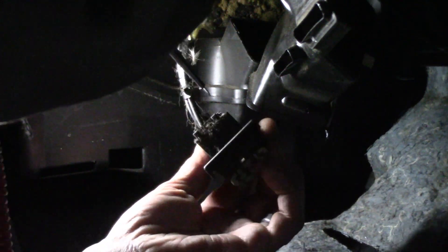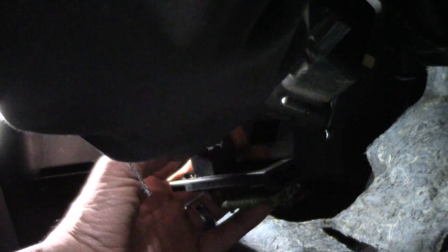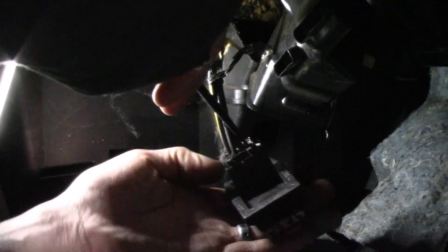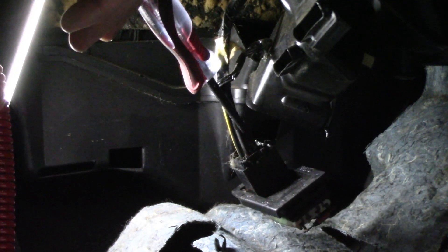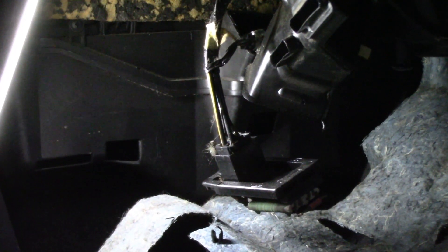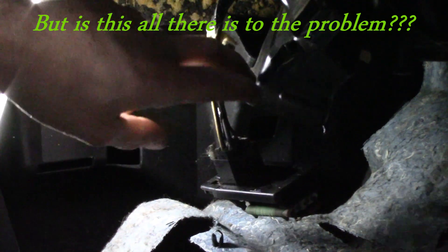Now I'm going to shut the blower off and go to the black and blue wire. Into my black and blue wire I have no output — nothing — with the blower on. This was quite easy to see what was wrong as soon as I actually looked at the plug.